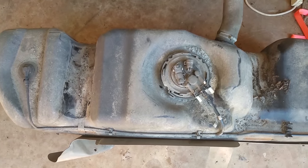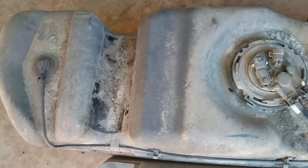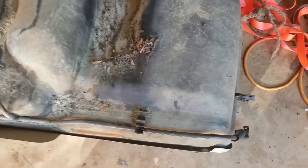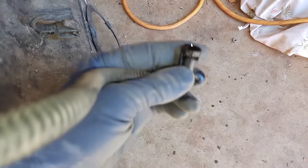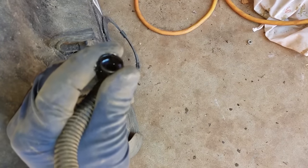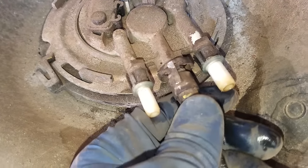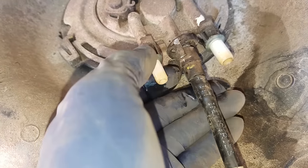We got the tank out. Our heat shield was bent from some off roading but we're going to bend that back. You can see the top of the tank here is really dirty so we're going to have to clean this up. You can see where that line is right there — this one is a pain to get off up under there if you can't see what you're doing. It's bigger on one side than the other and you squeeze it like that and just pull it off. You can see where the other lines were clipped on there, and that connector — you just squeeze it here and here and pull them off.